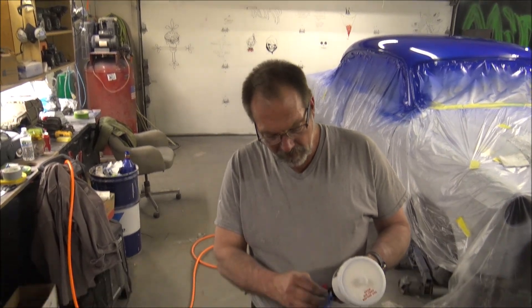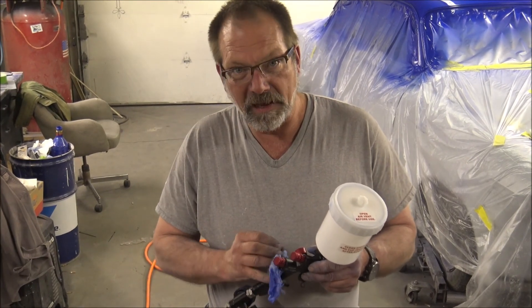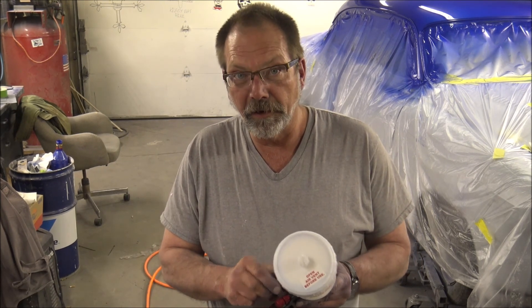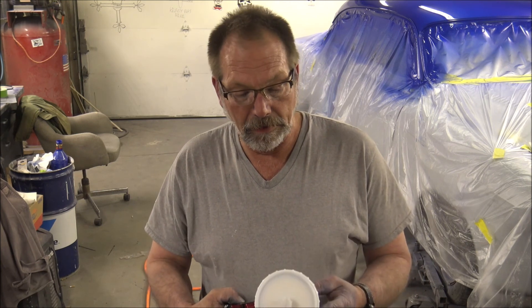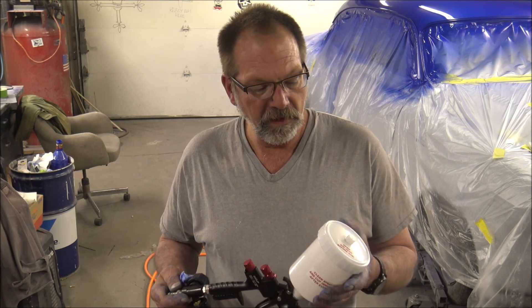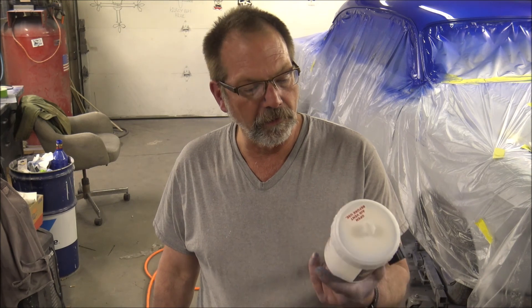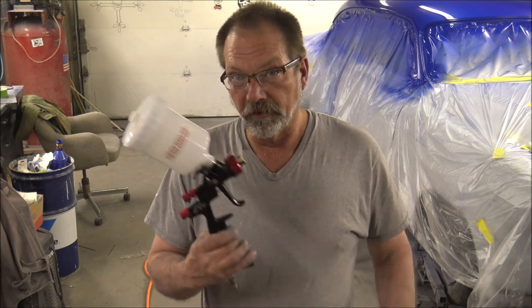So remember we were talking about this handy dandy new paint gun we bought — Black Widow by Spectrum from Harbor Freight. Wasn't sure what to think about it at first. It was dripping paint, and after doing a little playing with it we got the drip to stop. That problem was solved, and then we weren't moving enough material so we just backed open our material needle and next thing you know we're moving material. We were getting a 12-inch pattern and laying it down nice and wet. Worked great. This was a single stage paint, no clear over the top — it'll dry with a satin finish. My end result on the gun: great gun, sprays beautiful. Once we got past the drip it was perfect. The only thing I didn't like is the cleanup — this cup has got to go in the garbage. We'll put an aluminum cup on it that cleans up a little easier; otherwise every nook and cranny still holds color. So there you have it. I think it's worth the 200 bucks. Thank you.